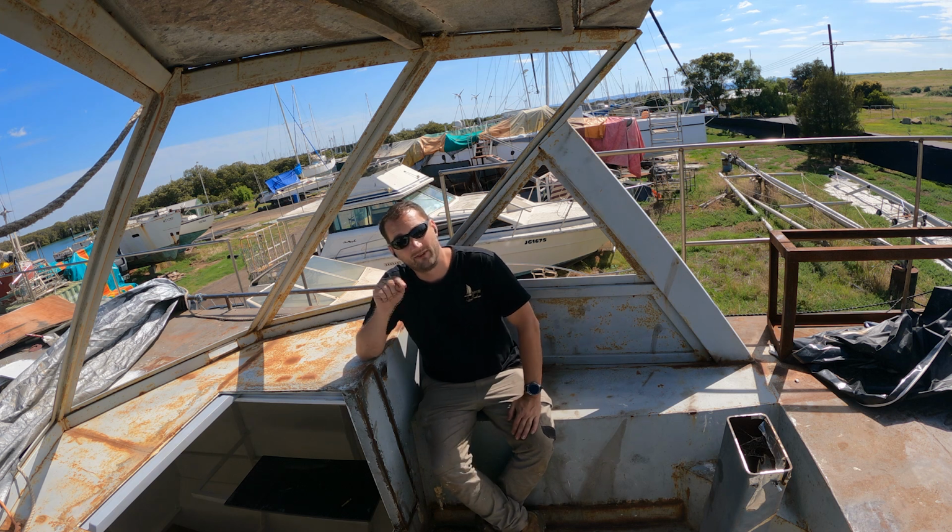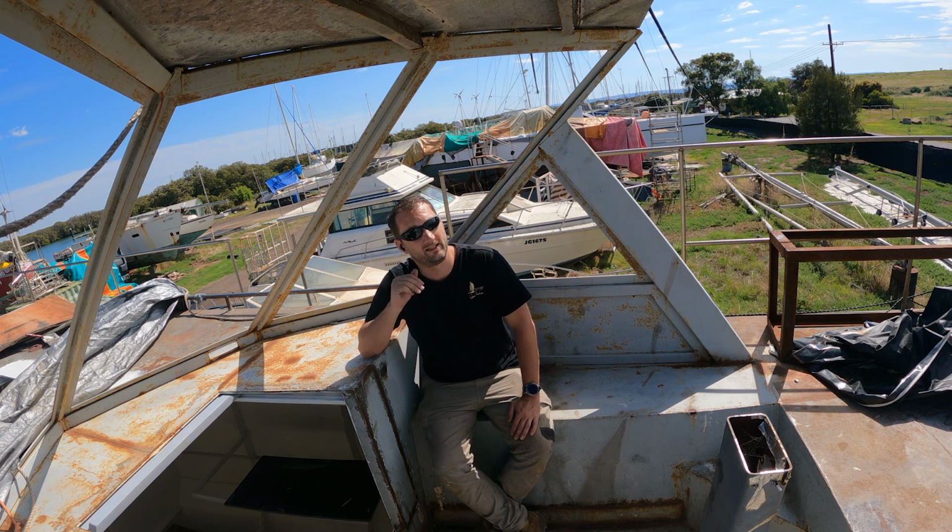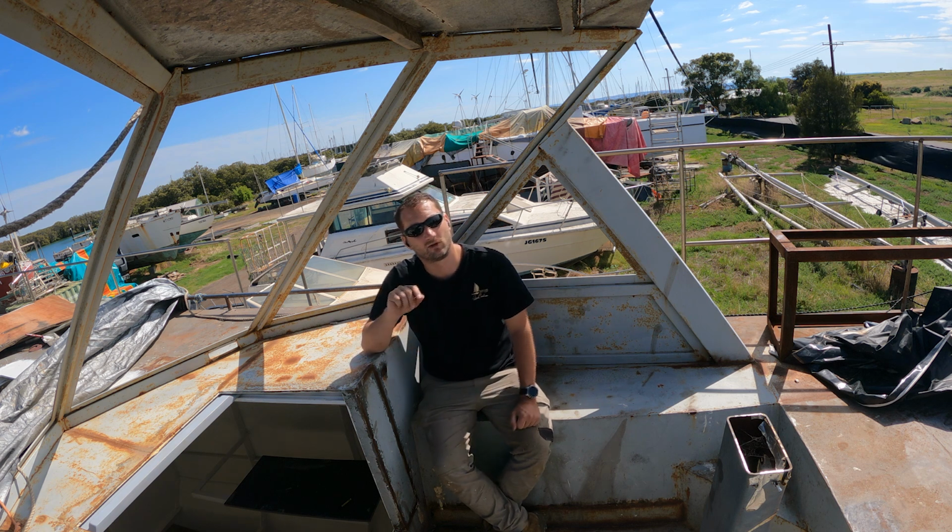What I'm going to be doing this time is getting some adhesive rubber and putting that around the edge rather than Sikaflexing them down completely, because when I go and paint this deck, I'm unsure whether I'm going to be spraying, or rolling, brushing and tipping, or how I'm going to be painting the deck. So I want the option to take them off.